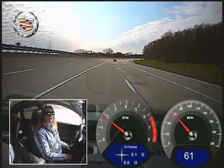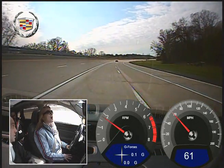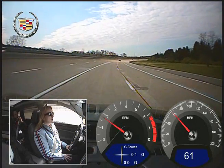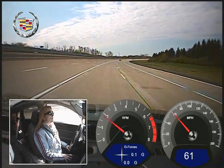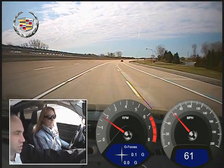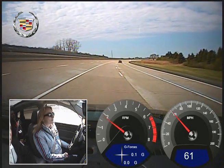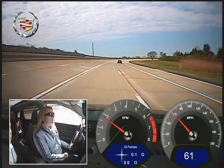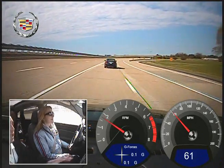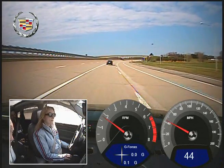WD, get ahead of us. We're going to stay at 60. He's going to get a little bit further ahead, pull over into the right lane, slow down to 50, and then come in front of us when I tell him to. You don't need to do anything — don't react. If you get nervous it's fine to do whatever you want, but you don't need to. WD, go ahead, slow down to 50 and pull into the other lane. What you'll see is this should indicate that there's no in-lane path ahead. You're set to 60 miles per hour, he's going 50. WD, now — so someone cuts in front of you. It backs off to try and get back to that two-second headway, and when it's at a two-second headway it's going to come back to his speed, his 50 miles per hour.